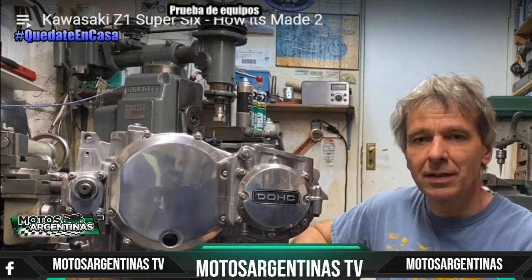and it's all ready for drilling. Now drilling, I use these special drills for sheet metal. They're absolutely brilliant because they start off small and they gradually get bigger and bigger, and you stop at the size that you want. But the main thing is they don't grab and they don't throw the job around everywhere. If you use an ordinary drill on sheet metal, it just grabs and shoots through too quick. This is just a nice way of doing that.